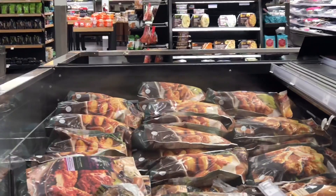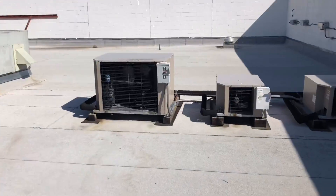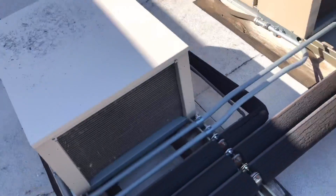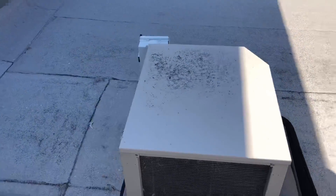Pretty cool air curtain - it's at 65 degrees with no refrigeration. Looking at the condensers: one of these three is running, that one's running, but that one's not running. So more than likely that's our bad guy. Let's see what we find.